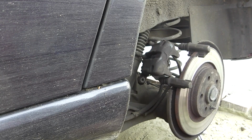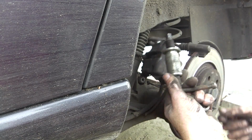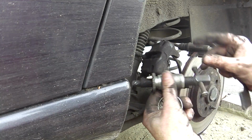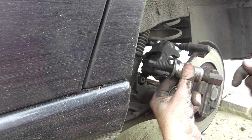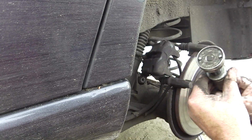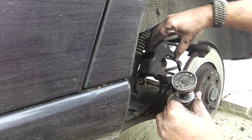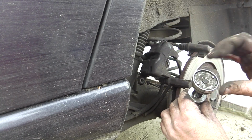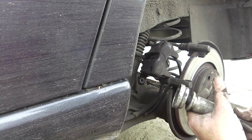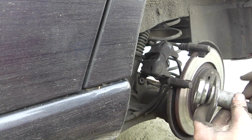Right. Now at this point, you have to have a special tool. It's a brake pusher. That screws in like that, and that pushes the cylinder in while screwing it in as well. That hooks on there. Those two lumps hook in with the two grooves in the top of the slave cylinder that I just showed you earlier. And then screw that in. So wind that all the way down. Hook on this thing, which holds it in the brake, and put it in.